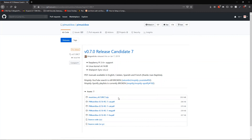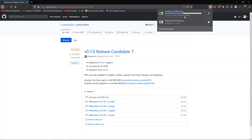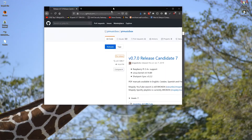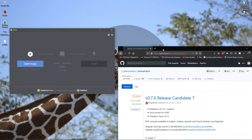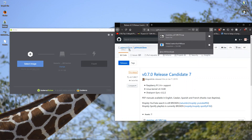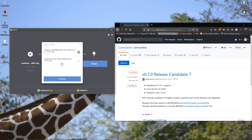If you haven't already, you have to plug in your microSD card from your Raspberry Pi into your computer through an adapter, or straight in if the slot is the right size. Now we're going to click on this and then musicbox.zip. Now you need to install a program called Balena Etcher. Basically what this program will let you do is put this zip file onto the SD card and install it correctly — you can't just drag and drop. So drag this into Balena Etcher.